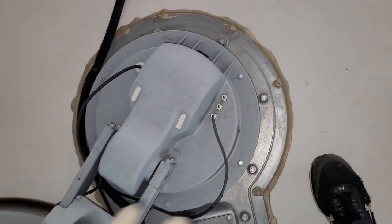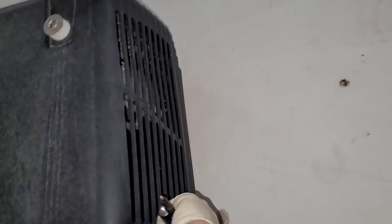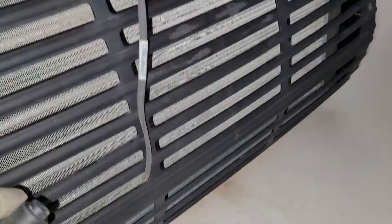On the last slide out and in the galley, that topper looks good. This vent should probably be touched up and resealed with sealant. This looks fine. I did already check the AC for tightness — shroud looks good, condenser coil looks good. We'll do the next one up here real fast — shroud is secured, coil looks good.